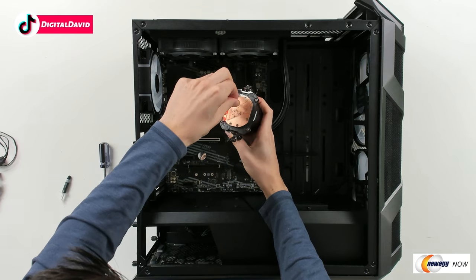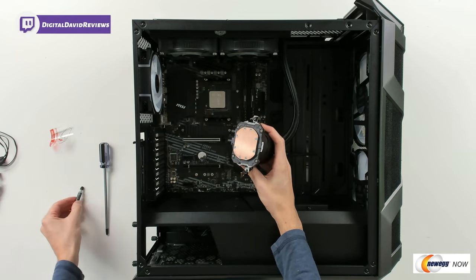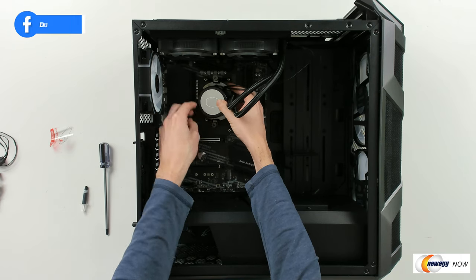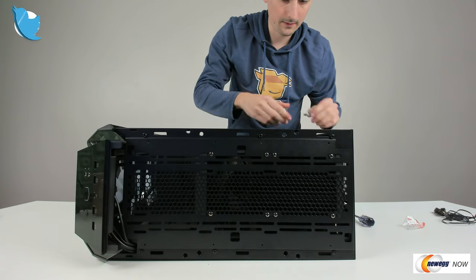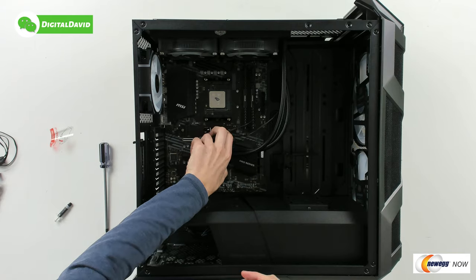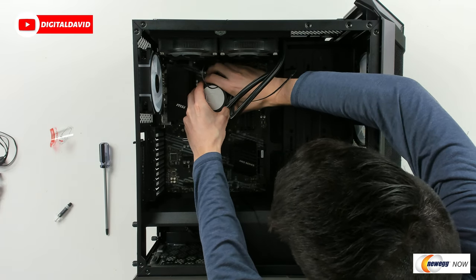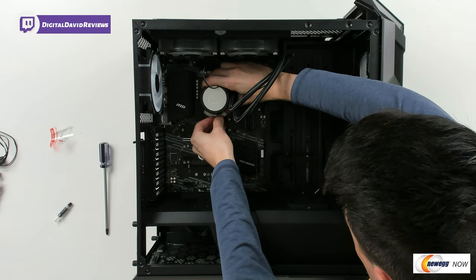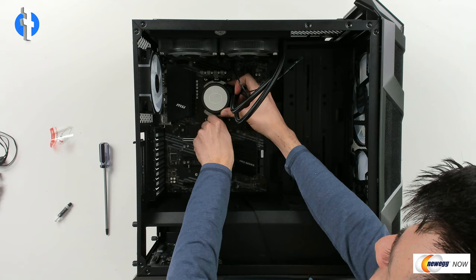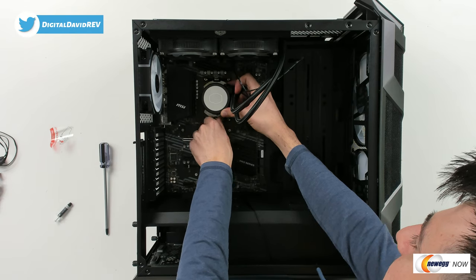Now it's time to go ahead — we're going to peel this sticker before installation. We're going to take our thermal paste and apply a pea-sized amount right here on the center of our CPU. And then we're going to take this unit just like you see right here and fasten it in place with the two brackets, one on each side right there. So we got our pea-sized amount of thermal paste applied. And now we're going to very gently line it up with both brackets and just gently tighten everything down in place. Just gently go back and forth — finger tight — alternating between the two instead of just applying the pressure unevenly on one side. Make sure both are nice and snug.